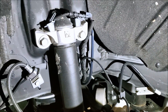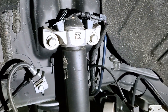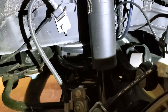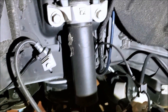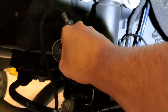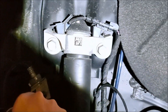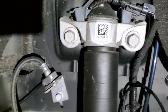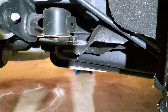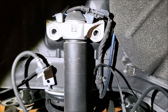Starting at the back of the car — wheel's off. First thing, undo this clip and those two up top. This is your brake line, so make sure you don't forget to disconnect that. You don't want it to drop and rip your brake line out — that'll make a mess of everything. Get the two bolts at the top undone and just drop her.